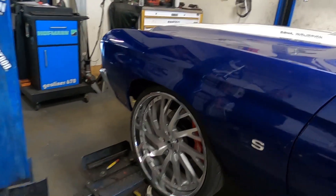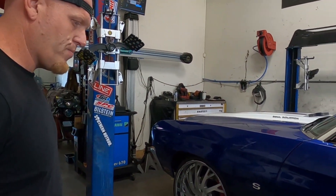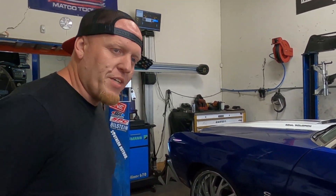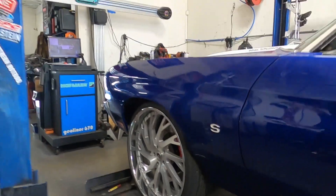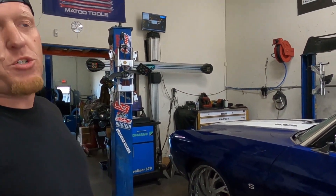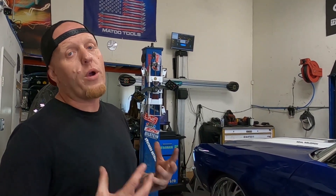We're having clearance issues with these monster 24-inch wheels. Mike explains there's always an option with alignment to get the vehicle to not rub — adjusting toe and camber, and getting caster forward or back depending on where the upper ball joint inclination is with the aftermarket suspension. With aftermarket suspension like Ridetech or QA1s, your numbers will never go back to OEM specs — caster could be minimal or even negative — it will be completely different from factory specifications.